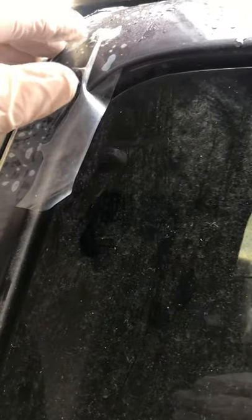What you've got to be careful of is the mirror is beveled, so don't rest it on the thing otherwise you'll break the glass. And you want to get the top unit off — it's just two bolts and you'll need a T30 star socket.